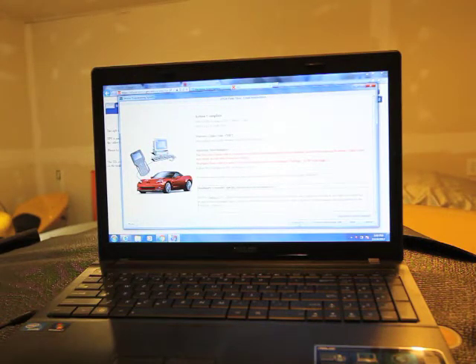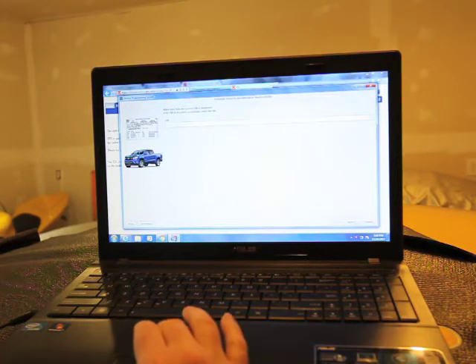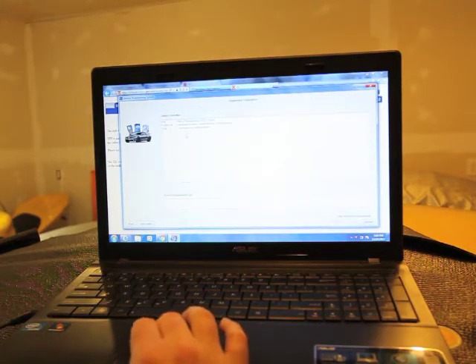With a computer that's pre-flashed — or if you buy one from us that's pre-flashed — you'll have to do a 30-minute key relearn on it. If you have access to the Tech line or the Service Programming System, you'd be able to go in and if you go to 'proceed with same VIN' after you flash your controller, if you had the VTD relearn option it's going to be listed right there. The VTD relearn option allows you to do a 10-minute security reset. So when the dealer flashes it, or anybody with an SPS terminal re-flashes it, they'll be able to go do the VTD relearn — set it, and forget it. 10 minutes later they come back, cycle the key, and the security's been reset. Without that, the manual way is to just do the 30-minute key relearn.